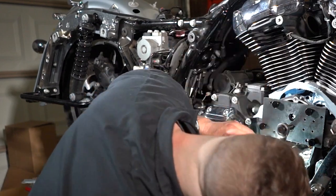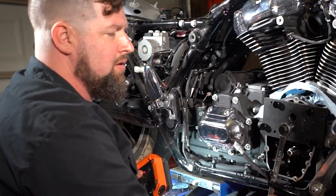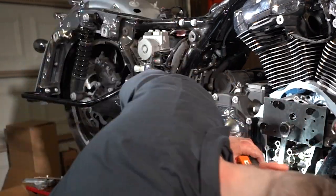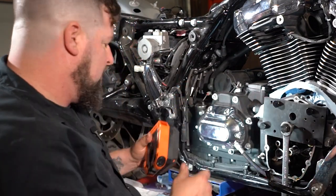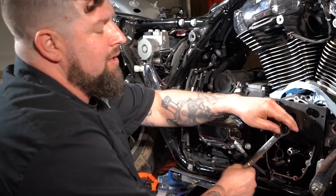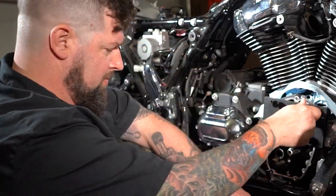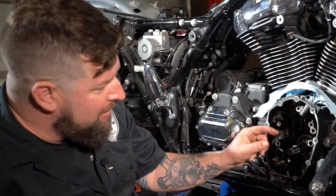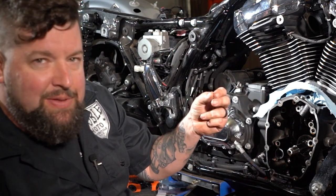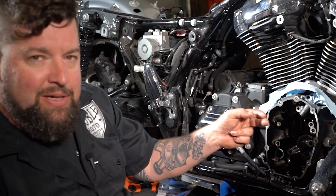Take a peek — everything is going in all nice and even as it should. Right there, it just stopped. Spin the ratcheting wrench around and crank it back on out of there. Now give it a look in there and make sure your cam bearing is sitting back into the engine case. You don't want to have it stepped out or anything, or when you put the cam in there it could bind up on it. Make sure it's set back in there a little bit, and you're going to move on.